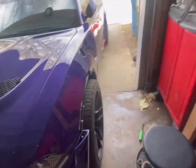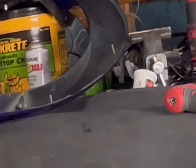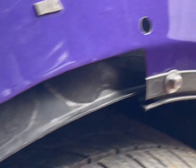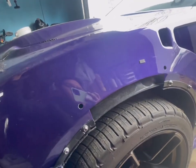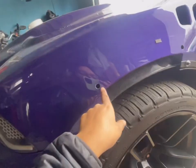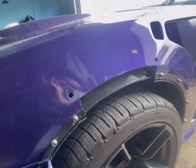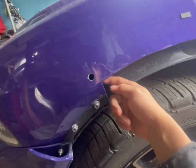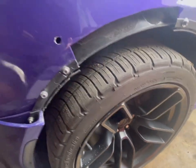I found it's much easier to glue the bolts on first, then use a little paint — while you're putting it together that paint will touch where it meets, and that's where you start drilling. With the other side I did the holes first and tried to do the bolts and it was very hard to line up. So it's better to put the bolts first. To prevent rust, instead of spray painting I grabbed some coating and dabbed it inside so we know for sure it won't rust.